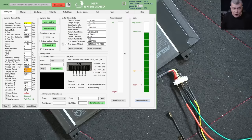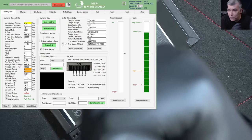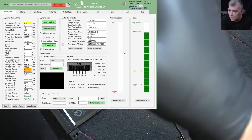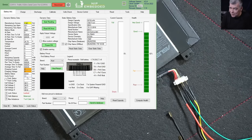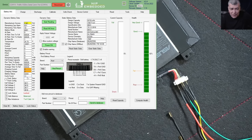The charging voltage is zero because the battery is locked, and the cycle count is 11. So the customer charged and discharged this battery only 11 times in 4 years. This is a gaming laptop that was probably always plugged in, and the battery died without being used. This is a clear example — even if you don't use the battery, it still loses capacity over time. 11 cycles — this battery is basically untouched.